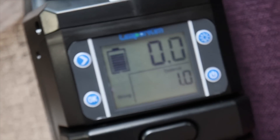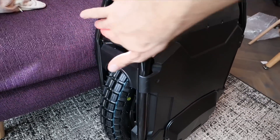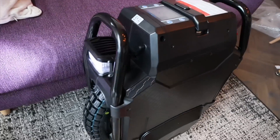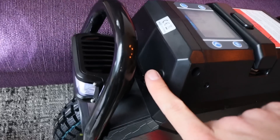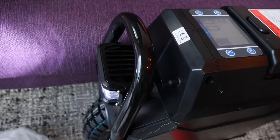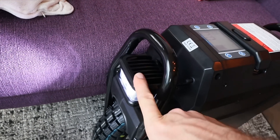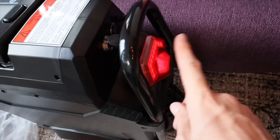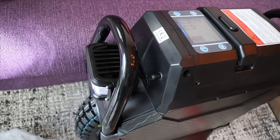After that small jump in the timeline, back to voiceover because my wireless mic discharged. The first thing you want to do when you receive your Sherman is plug it in to get it out of transport mode. Now I'll set up the Sherman and check out its features. First off, the light — it's the most powerful light on a EUC currently on the market. It does blind people but I think I can set it up better. You can also tilt the headlight so it points in the right direction, unlike a Gotway. There are also heat sinks, and the light is connected via a regular audio jack — it's a 12-volt light and easily replaceable. The same is on the rear with a tail light, but the tail light is a 5-volt unit. I'll be thinking about mounting something more powerful in the front, and definitely adding additional lighting to the roll cage that is provided on the Veteran Sherman.